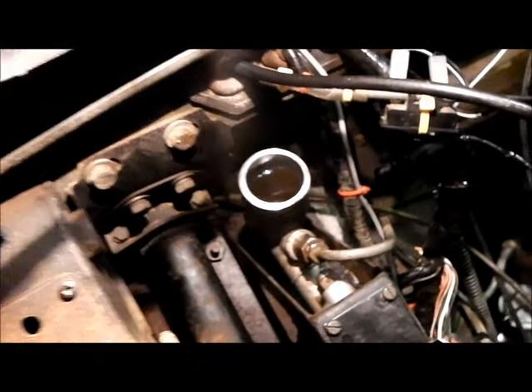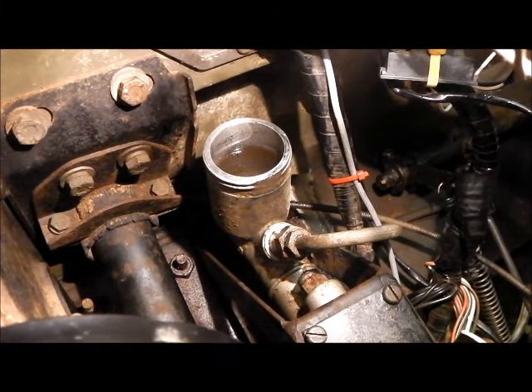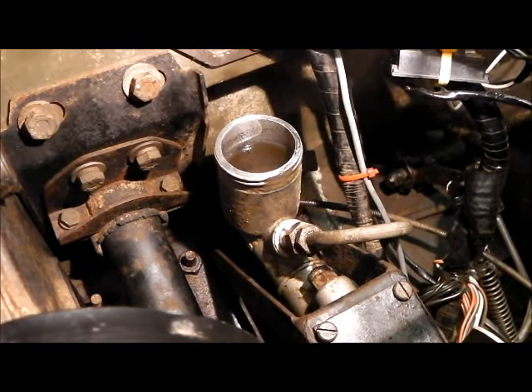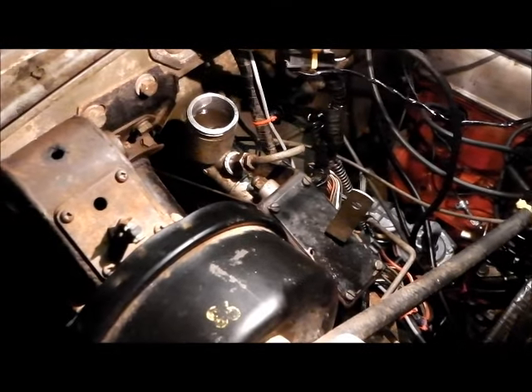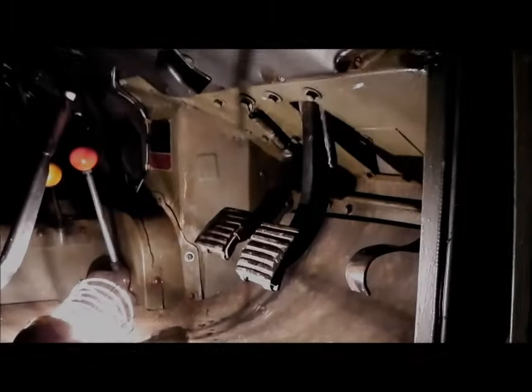You can see the clutch fluid there looks quite dirty. You might also just be able to see this sort of line of black goo around the top of the reservoir - that's bits of the seal - so that's a sure sign that your cylinder is failing and that will be working through the system. Before removing this we need to drain it down, but first there's a little oily streak visible inside. That does get worse when it's stood overnight; as you drive it a bit of fluid seeps out and drips down through the pedal box, so it's one of the things you need to get on and do.